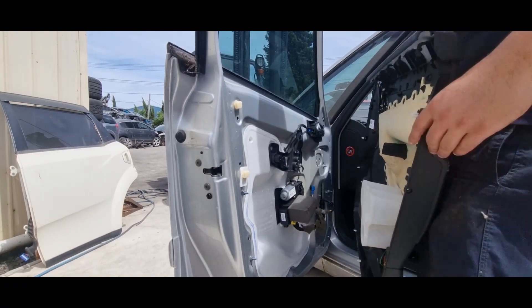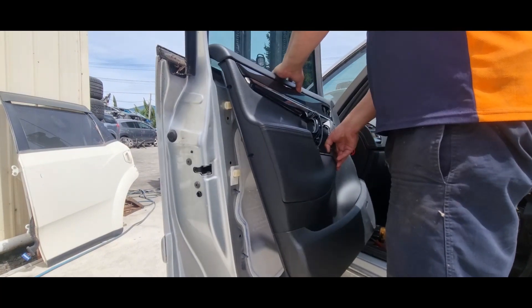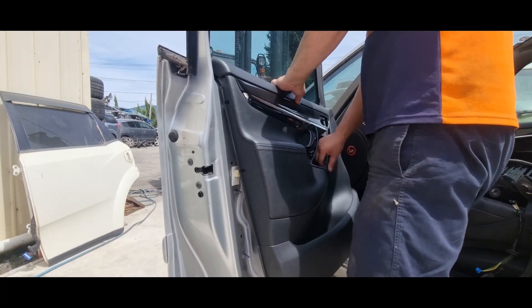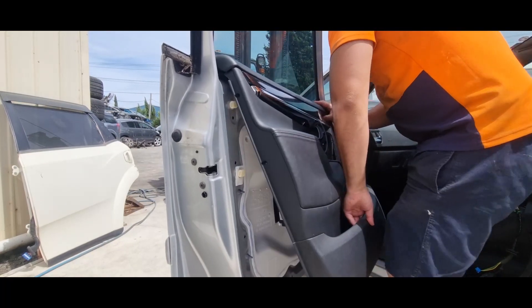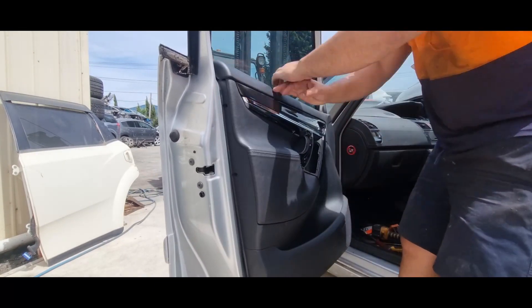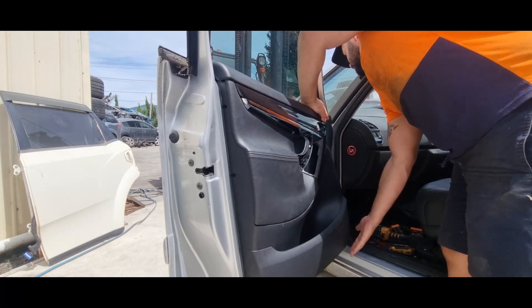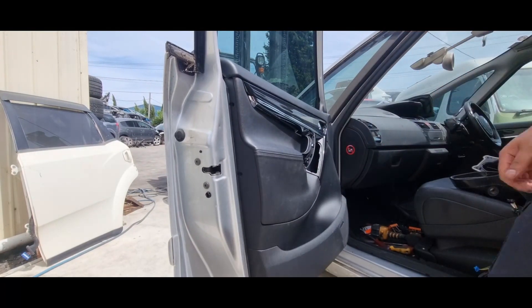Here's how to perform putting on the door trim: first you want to put the top side and slide it in downwards into the windowsill. Once that slides in, if you put the clips onto the trim side it'll just be a push-on kind of effect — a few slaps here and there. This is pretty much applicable to all vehicles, even though this demonstration is from a Citroën C4 Picasso.